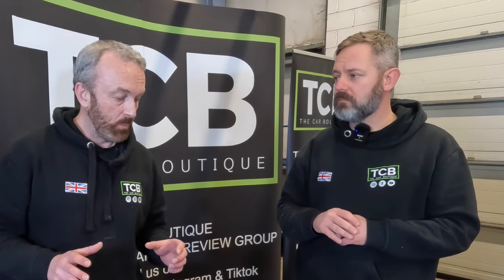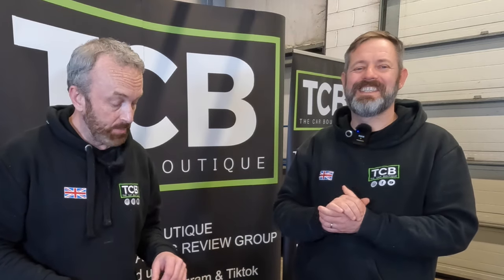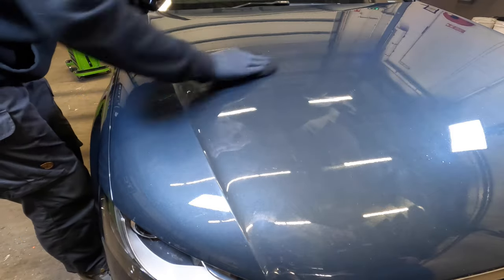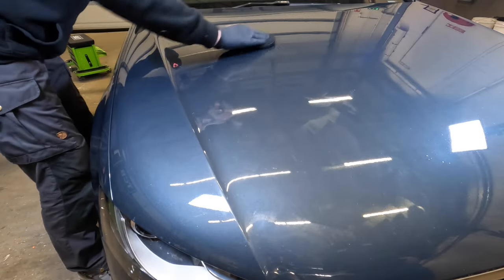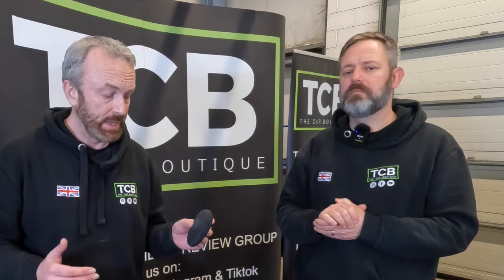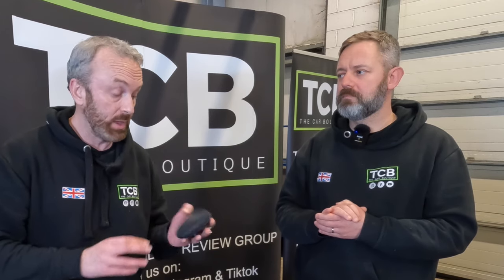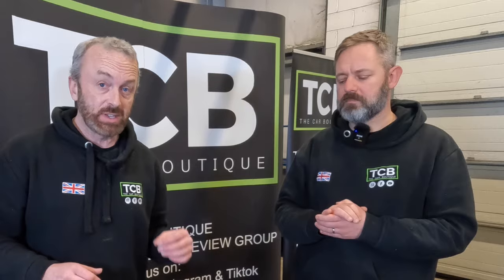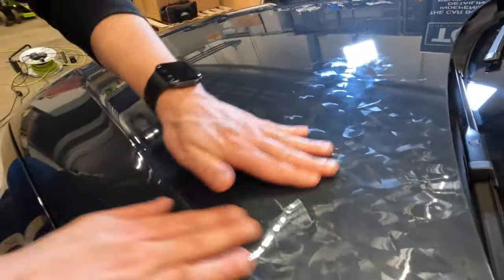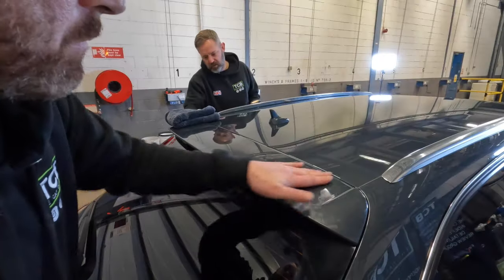Now, what I found, disagree if you want, Carl, that's why you get two for the price of one, is about application. We did the demo using this applicator, and a lot of the waxes we've been using have been heavily solvent-based, quite greasy waxes. This is a high carnauba content, so it's dry. Although I found it okay to apply with the applicator, you'll see some videos of us both playing with using our hands. Your high-end waxes like SWISSVAX, you watch a lot of videos, people are applying by hand.